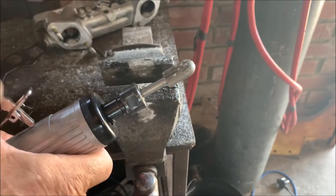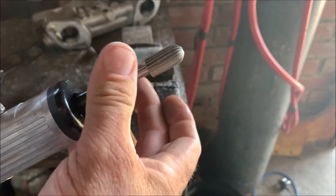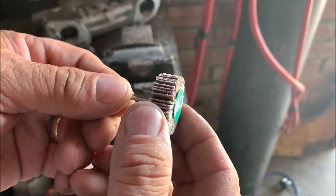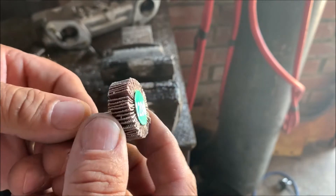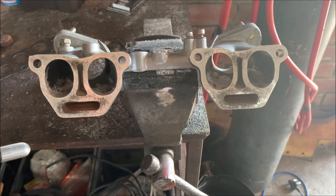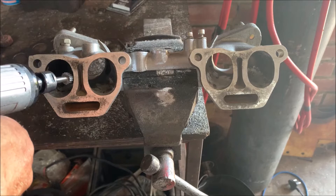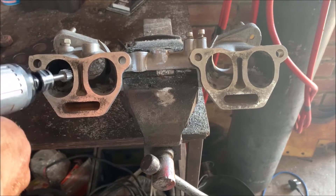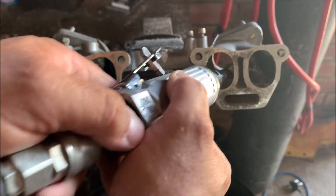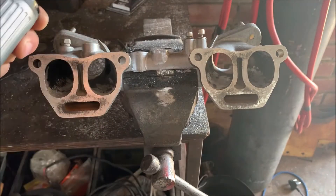For the cutting I use my air tool with that little cutter in it - works really well. And then for the polishing I'll use these. Just a little tip when you're cutting away on the inside there: get the angle that you do it and stick to that angle, then transfer straight to the other side at the same angle, and if you do it you'll come out in the middle. Then you do the same on the other side.